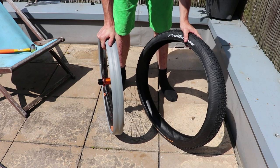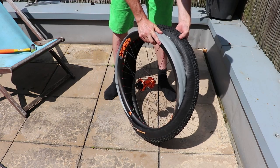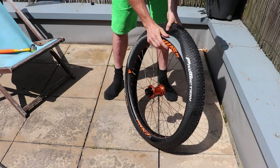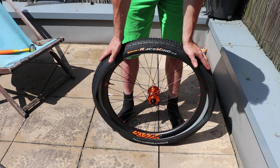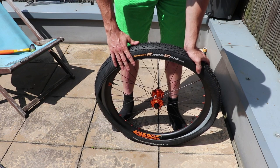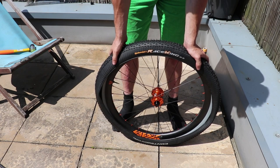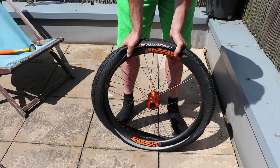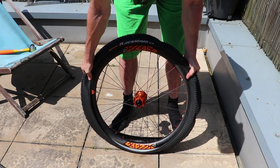Now this is going to be a bit of a tricky part — fitting the tire over the insert. Best bet is to put the insert completely in the tire and just try and get the bead over both sides like that. Once you've got your wheel dropped into the middle of the tire, you're now going to try and get the first bead installed. One tip which helps quite a lot if you're finding this bit particularly tight is to use some soapy water as a lubricant to make the rubber a little bit more slippery. The technique is to roll back, push the insert in, and try and fit the tire bead in between the insert and the rim — then just go around the rim feeding that bead in between the two.